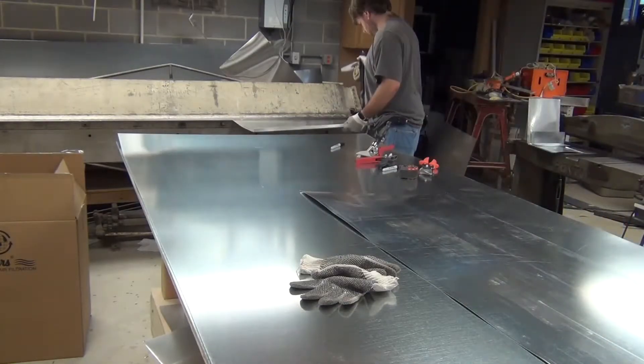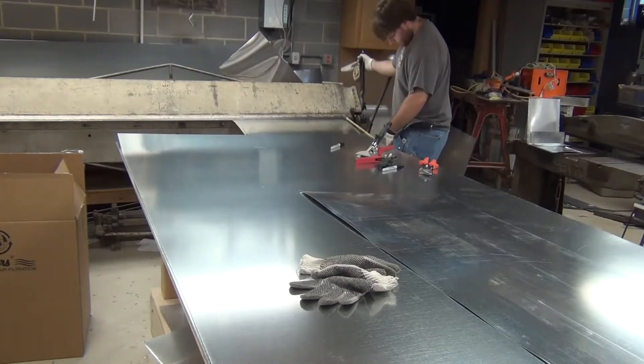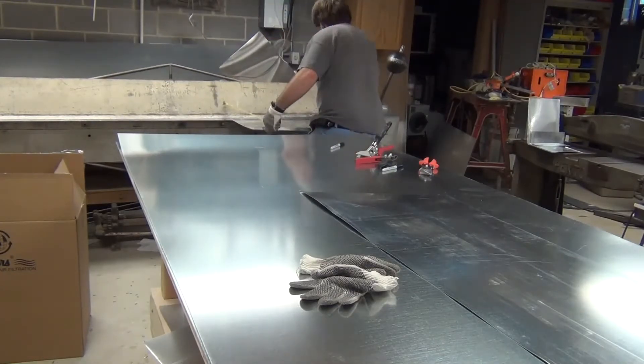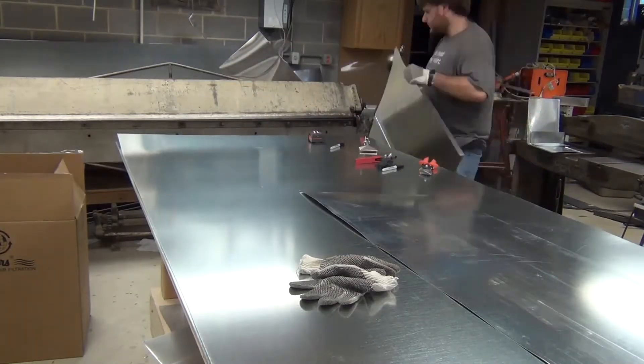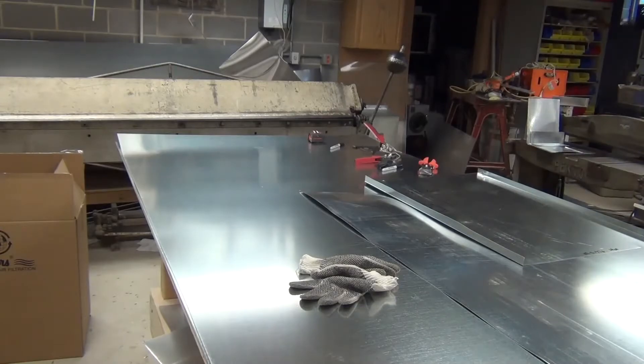I made a panel that will span between the two pillars in my rack. It will be held in place using the same cage nuts that my servers use. Its purpose is to not only hold the manifold in place, but to protect the servers. If there was a leak, or if I was just disconnecting a server, the panel would prevent water from being sprayed onto the servers.